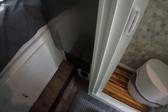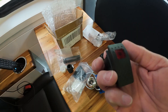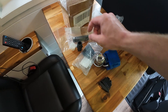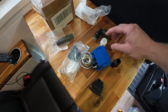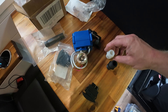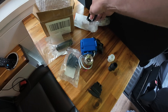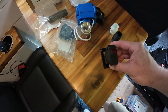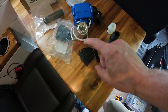We want to fuse that pretty small — probably about five amps. I've got a single-position switch; it will be lighted so I remember that I have the valve on. I ordered a pack of those. I don't have links for all the stuff in the description — I just ordered a couple of various half-inch pipe fittings. Now, if you have a three-quarter inch hole in your tank it will drain faster with a larger hole, but I'm working with what I've got. The time to do this would have been when building the van, but luckily I left myself ways to access everything.